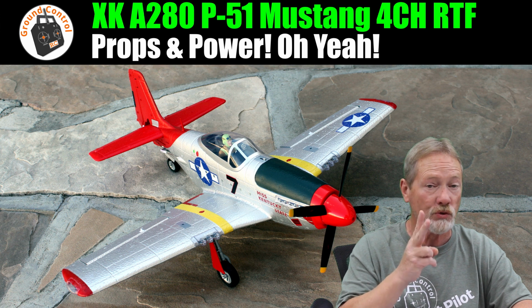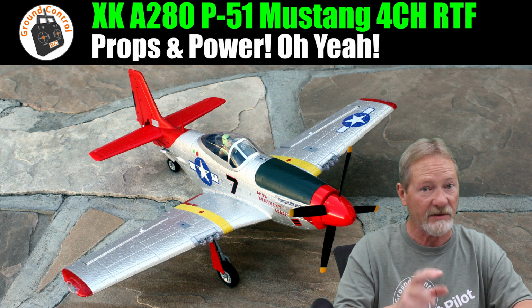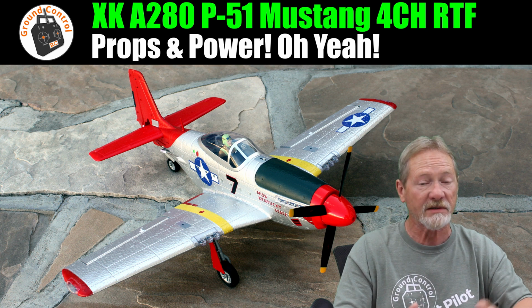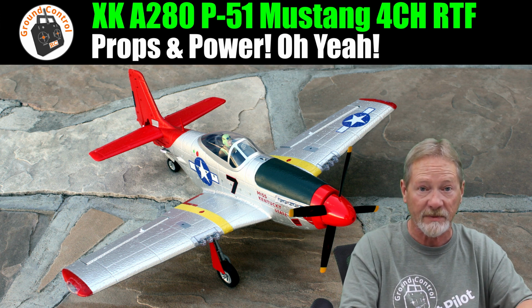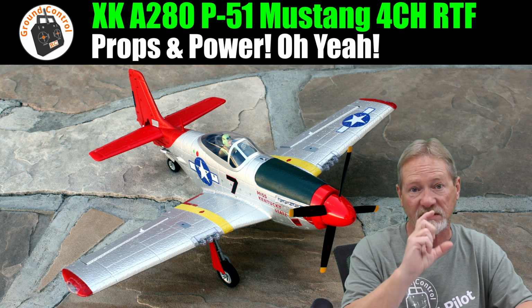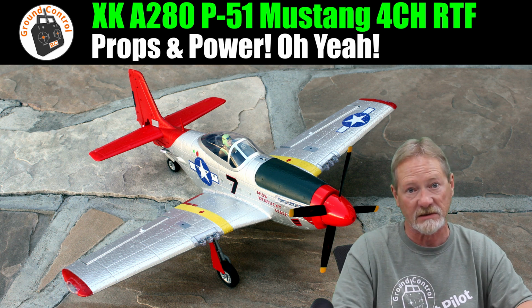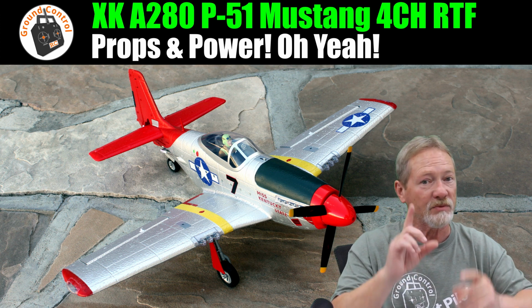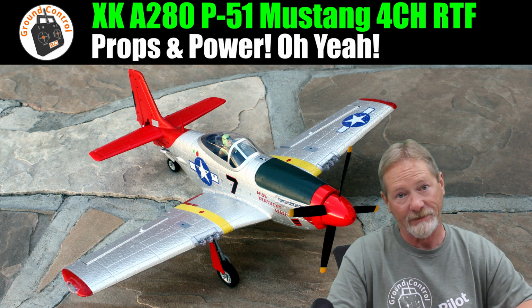Okay, I had to use 2 6mm diameter spacers with that 7x5 prop. A lot of the times that I purchase APC props directly from APC, you got to pay extra. You got to buy the spacer pack separate. It usually only comes with 1 or 2 spacers, different sizes. So the 5-pack comes with 2 full packs of spacers. You're going to want those to adapt them to the plane.